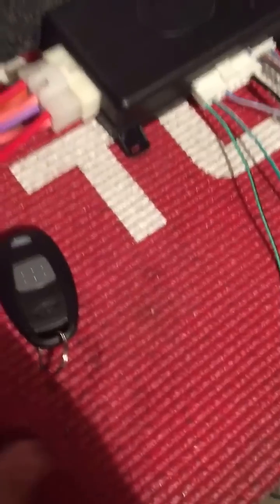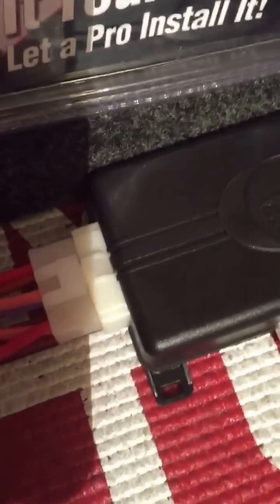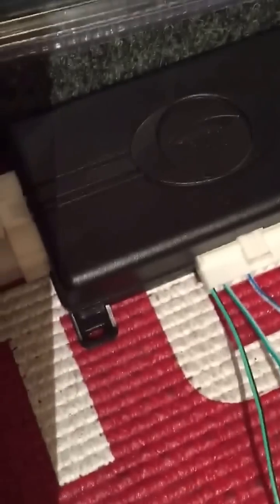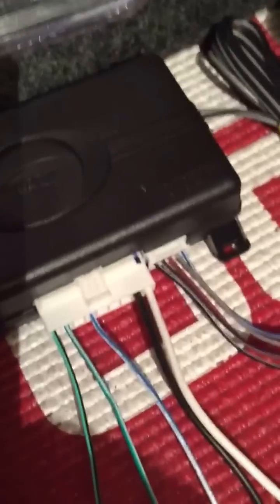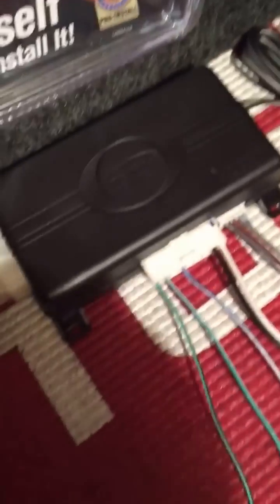I know it's a lot of information all at once. So again, to recap: ignition wires here, then push button and antenna, your parking light jumpers in the back, and then parking brake, ground, activation input, and factory alarm disarm wires over here. A lot of these connections typically go under the hood or under the dash. If you've got any questions, go ahead and throw them in the comments section and I'll get back to you as soon as I can. Catch you in the next video.